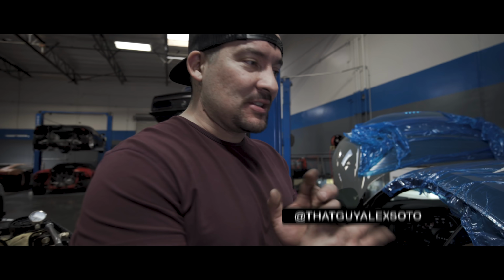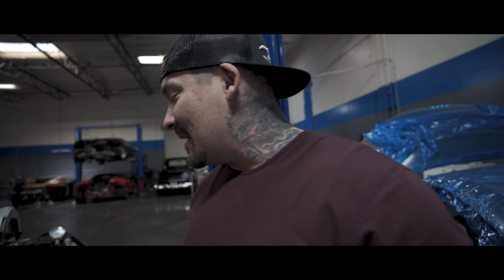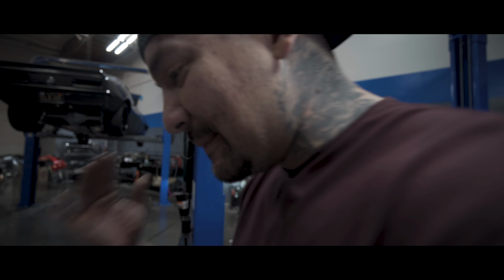Check engine light would tell me if a sensor's unplugged or something's unplugged. So first and foremost, fuel pressure was too low. Got fuel pressure set. Then it still had a check engine light. So in Motec, lovely, you don't need different CanBridge files and flashing this and flashing that. It's as simple as a click.